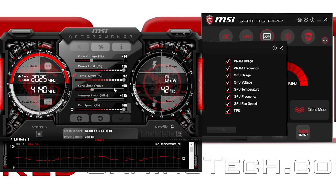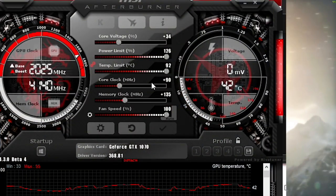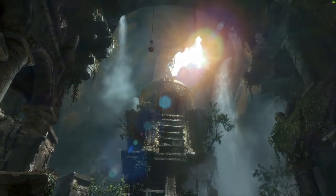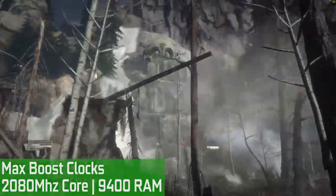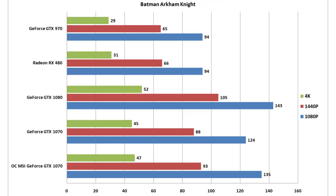Overclocking Pascal relies on an offset, and the GPU will dynamically raise or lower its clocks depending on how complex the scene is — complex scenes push the GPU to raise its clocks for performance, and vice versa for simpler, less taxing scenes. We managed to crank the Gaming X to 2080MHz on the core, while the RAM went up to a staggering 9400MHz effective, providing an increased performance of around 10–15%. We suspect it's not heat throttling the card from going higher, but power draw, despite maxing the voltage values in Afterburner. At such speeds, the card is within spitting distance of the GTX 1080 in many benchmarks.